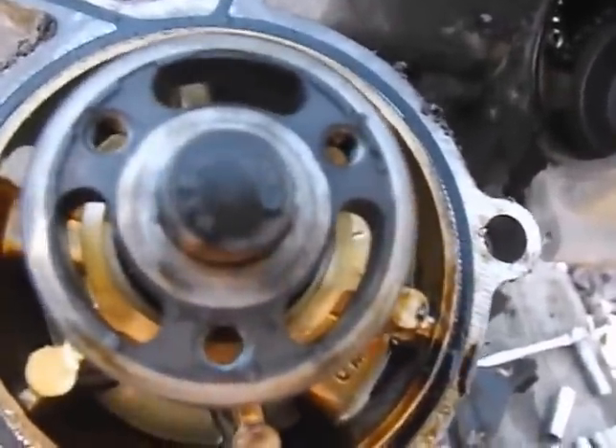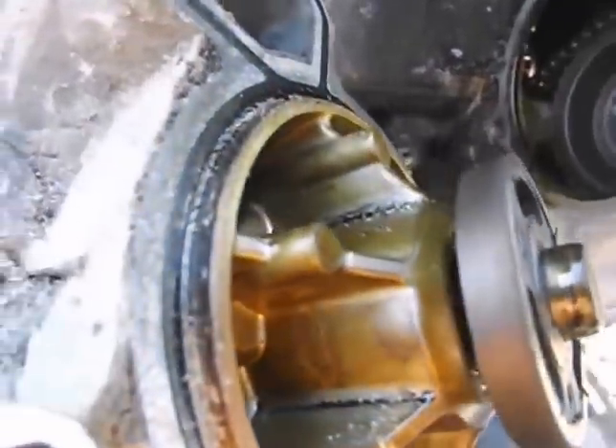You maneuver it enough until you can remove the water pump. You can see those bolts off the wheel itself — the wheel inside there are the bolts that bolt to the water pump itself. Then you change your water pump and reverse the process for installation.